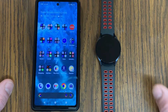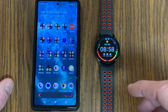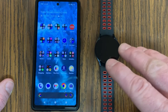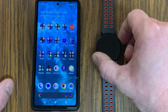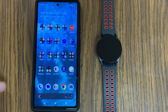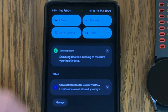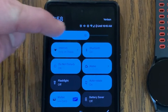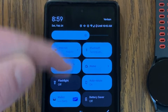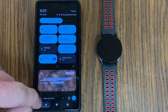Your Galaxy Watch uses Bluetooth and Wi-Fi to connect with your phone. Sometimes those accidentally get turned off, or it just loses connection for weird reasons. The easiest thing to do is toggle Bluetooth on and off. To do that on your Android phone, swipe down from the top of the screen — swipe down again to reveal all your quick settings buttons — and tap Bluetooth to turn it off and back on to reset it.